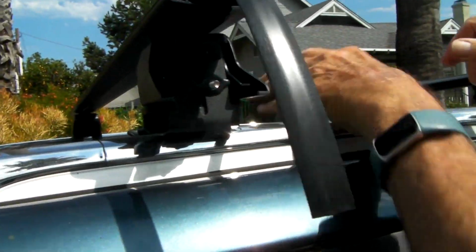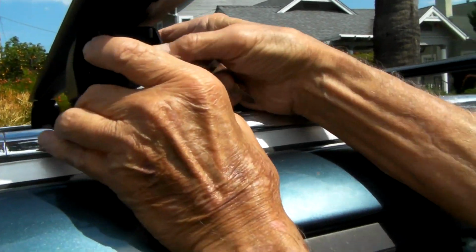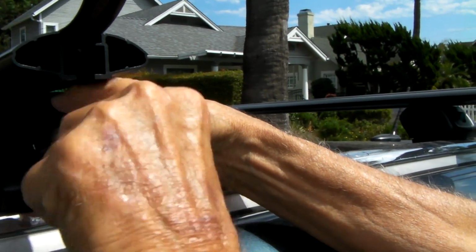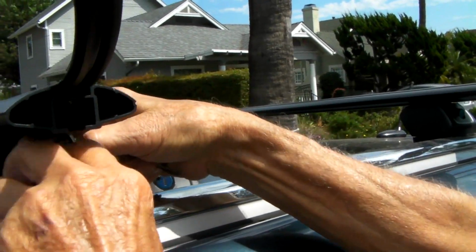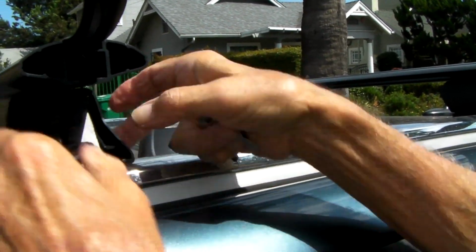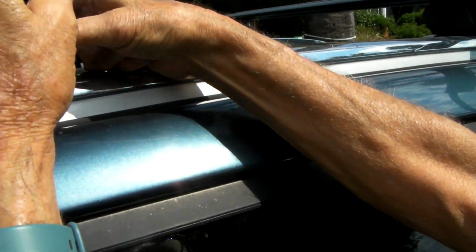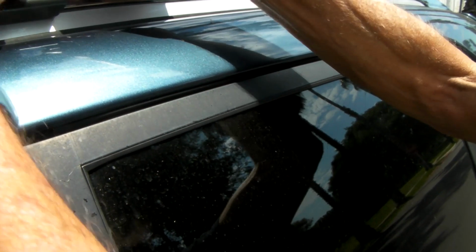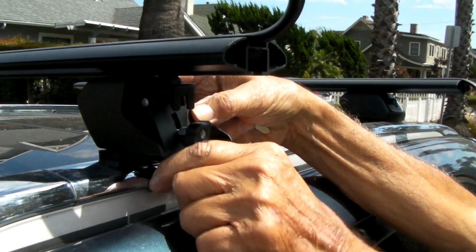Okay, so I'm taking the cap off and sliding it. Got to open this up enough to get the front clamp on. Just a little bit more because you got to go over the lip, right? I don't think you're over it at this point. There you go. Now you got it. You can pull it down, and so I'm letting the rail do the job of leveling the body. So now we'll turn it on here.